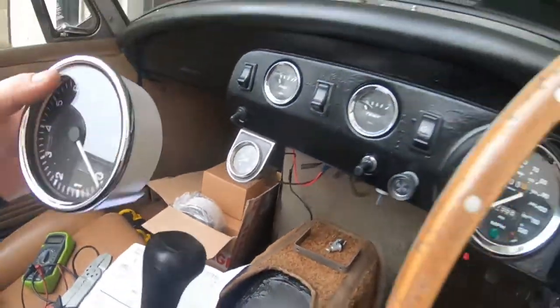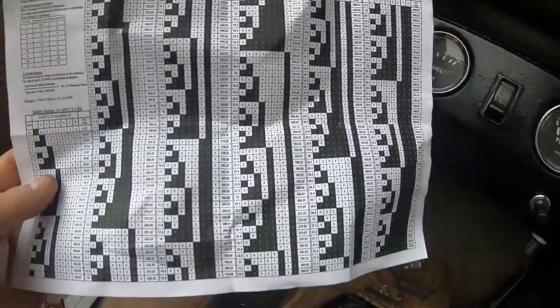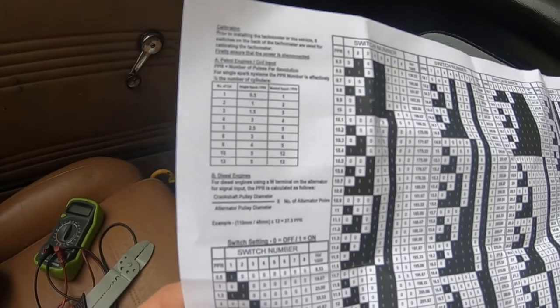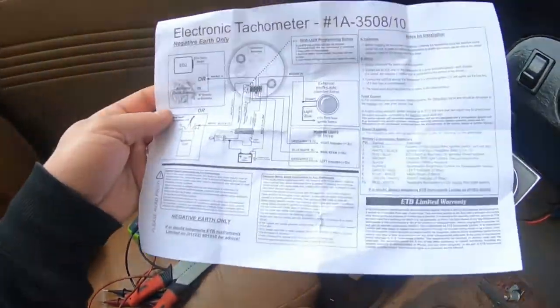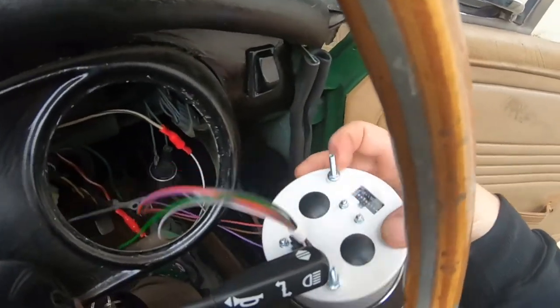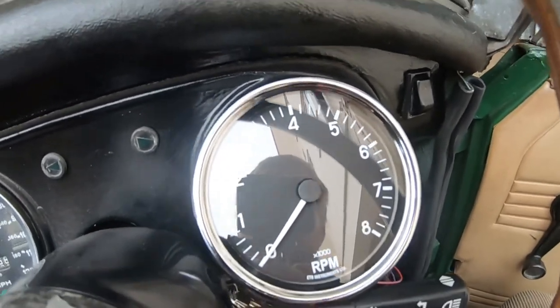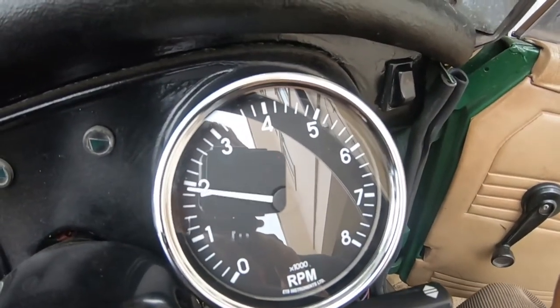All that's left to do is plug it in and try it out, then start the car up and see what happens. On the back of the tachometer there are a lot of tiny switches — these are basically all the possibilities of pulses per spark, giving you settings for 1 to 12 cylinders and whether it's wasted spark or single spark, which ours is obviously single spark. I've just set it up and — working tachometer! The neighbours are going to moan because I've started this about three times now.